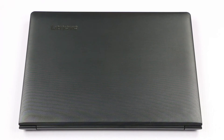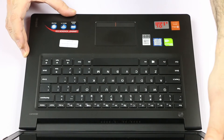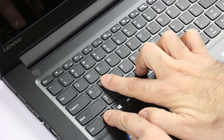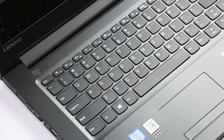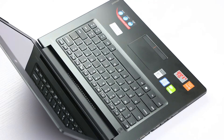Now that we are ready, let's get started. First, you will have to disable the internal battery. Open the lid, then press these three keys on the keyboard: the function key, S, and V. Now press the power button again. If the machine stays powered off, then you have successfully disabled the internal battery.